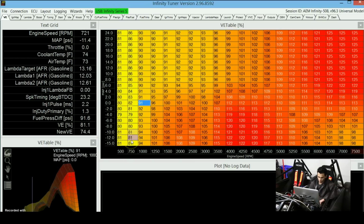So that means that the engine's MAP is right now at -12, and the RPM of the engine is at 750. So now if I slowly rev the engine, you will actually see this value going up along this range. Right now, since the engine is under no load at all, I wouldn't be able to take the MAP value up any higher. It will always stay in this line over here. But that's really where the dyno comes in.